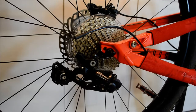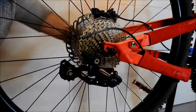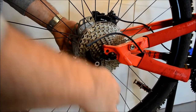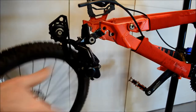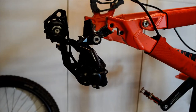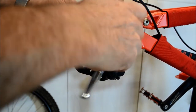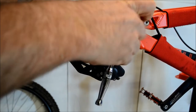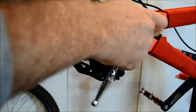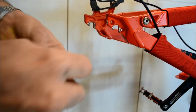Next, remove the wheel — just undo the quick release, move the derailleur out of the way, and the wheel will drop out of the dropout. Then remove the derailleur along with the mech hanger. Because of the system I'll be fitting, I need a different mech hanger. The BossNut Evo one fits, but the Go Outdoors one is apparently fairly weak, so I've gone for a Race TI hanger from eBay. Keep hold of the screws in case you revert in the future.